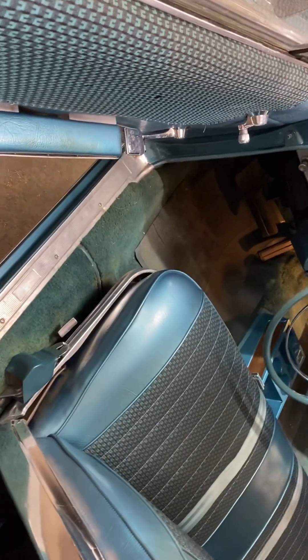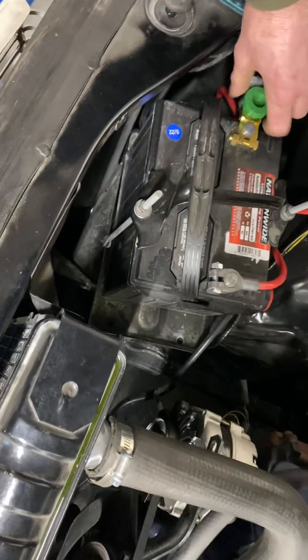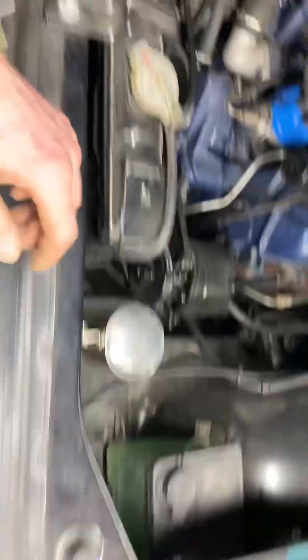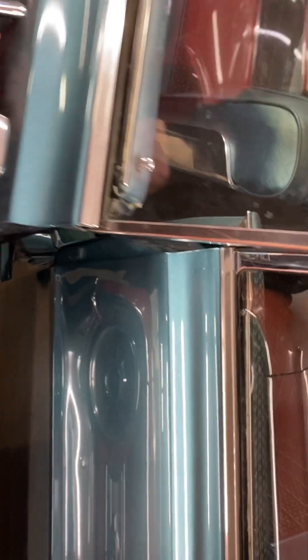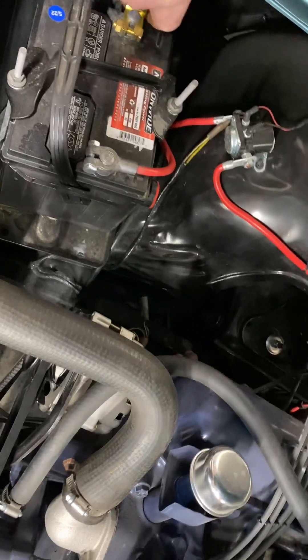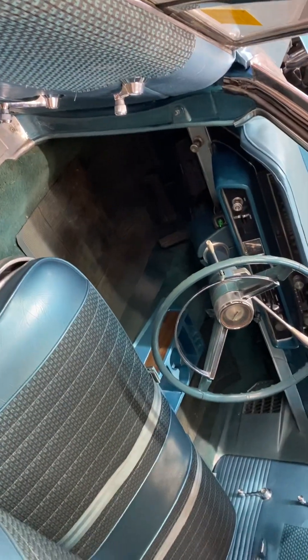So that's in there. Now for a quick test — we've loosened it off — let's go to the inside of the car and see if there's any power. Looking inside, there is power on right now. So we're going to quickly loosen that guy right off. I've loosened it about three or four turns. Walking back to the inside of the car — we still have power, so apparently it wasn't loosened up enough. Let's check that again. Now looking inside, there are no lights on, no power to anything.